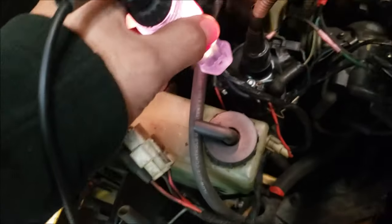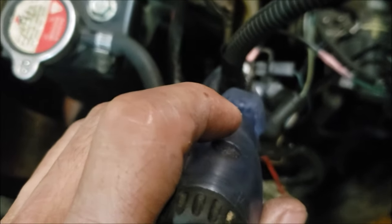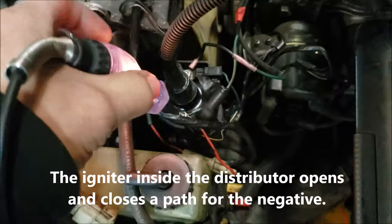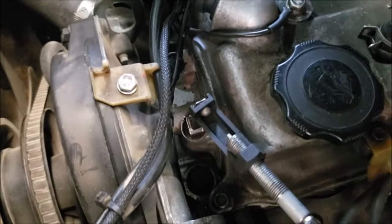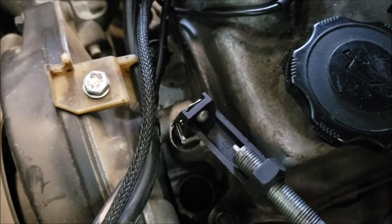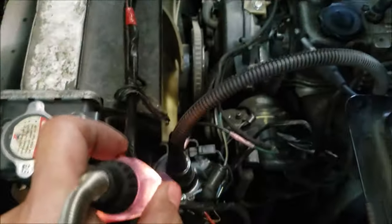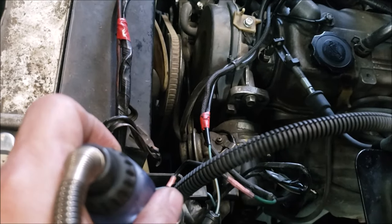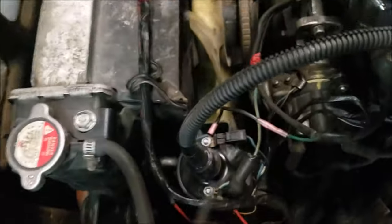The test light is lit — I have a positive. That tells me my coil is not open; I'm getting a negative through the negative part of the ignition coil, which goes through the igniter. So I've got a positive and I'm going to bypass that, focused on my spark tester. Bypass and crank — we got a spark! So the only thing we're missing is a positive supply to the coil.